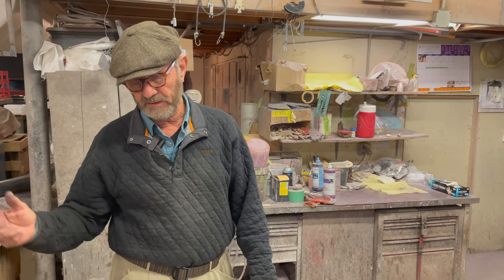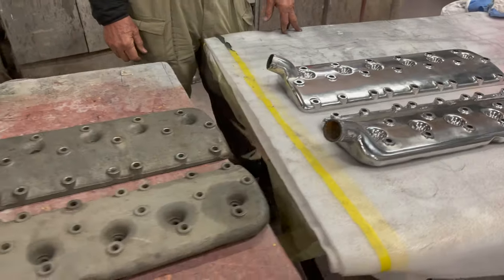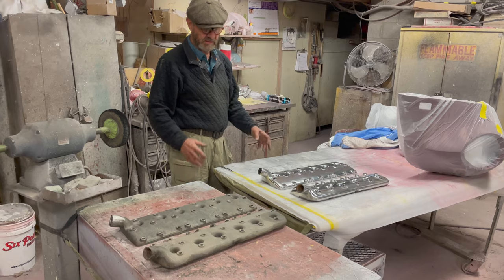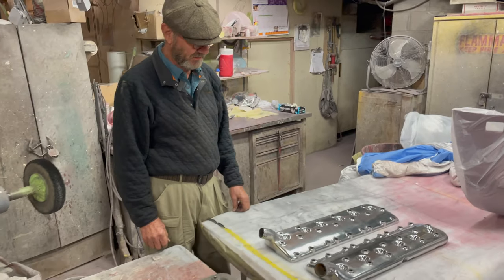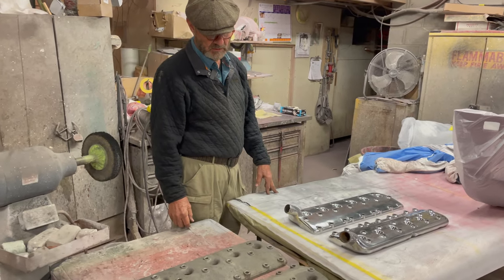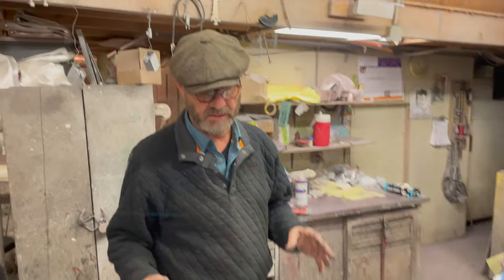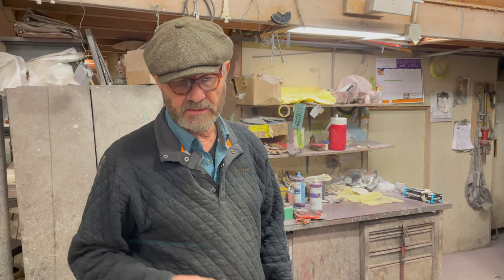If you're putting pure water in your car, that's fine if you're on the side of the road just trying to get somewhere — for short term that's fine. But you really should be running distilled water and antifreeze — that's a really good combination. It protects all the inner parts of the engine. I just get drawn to shiny things. What a difference — it really dresses up the engine. And then we're going to do another set which is going to be jet-hotted, which is where the heads are sandblasted so they're really clean, and then a ceramic material is applied and it's put in an oven and baked on so that it'll take the heat. It's also really attractive and we're going to do that on our next set after these two.